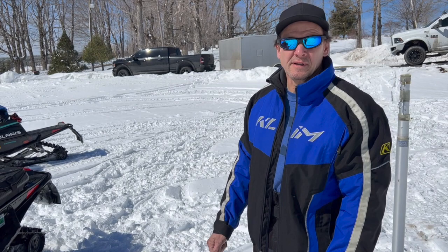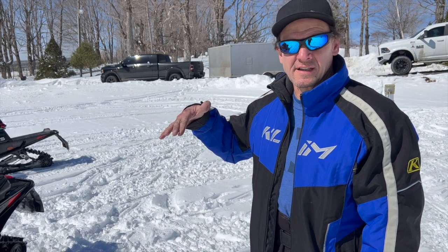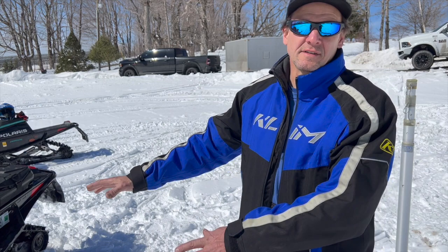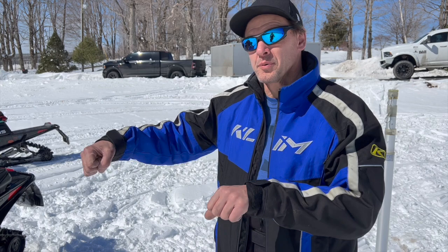When we're changing springs in the front and in the rear to get the right attitude of the sled on a trail sled, they're doing it to this. They're already giving it that attitude. They're putting big springs in the front to hold the front up, so when you hit the brakes, it doesn't dive and put the track on the ground and then want to push through the turn until you let off and get it reset, and then it'll go. This is made so that when it goes around the corner, the ski's got the right amount of pressure, there's not too much track on the ground, and it wants to turn.